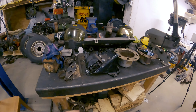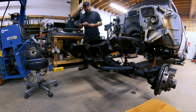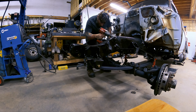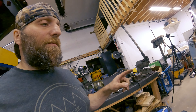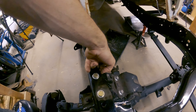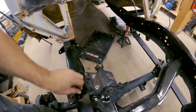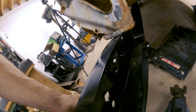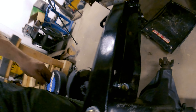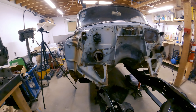What I'm going to do instead is move on to putting on the motor mounts — I've got one over here, and I went and picked up all my bolts this morning. That was a little bit more involved than I would have imagined. I do remember that they were a real pain to take off, and the biggest problem was getting at these bolts under here. There's a lot of messing around to try to get your fingers in here to get things all tightened up. These guys are kind of weird in here — you've got to get one in first and then tighten it down before you put the other one in, otherwise you might run into problems. But that side is done. Now on to the next side.